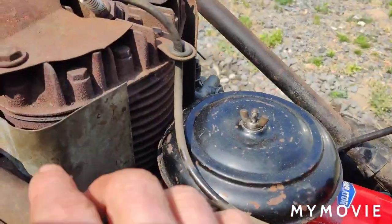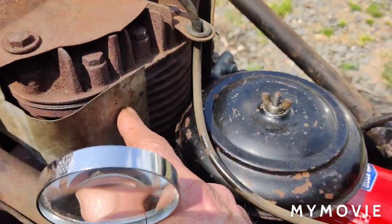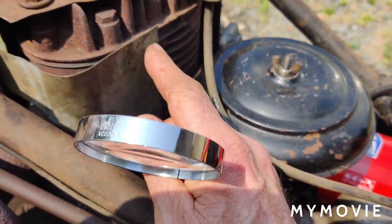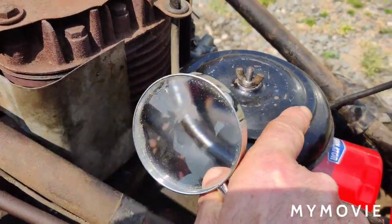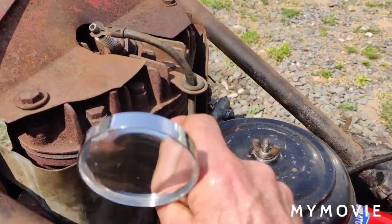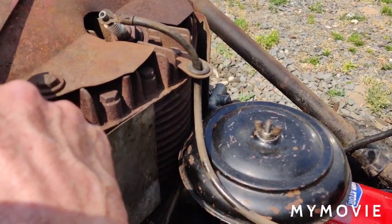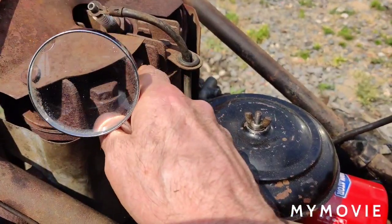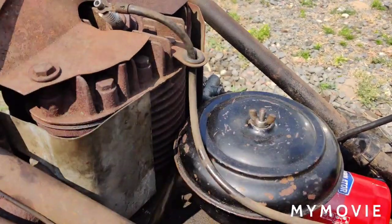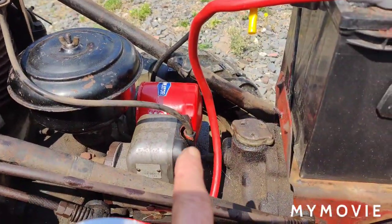Okay. So off camera, I don't know if you remember in the last video, I was complaining that I forgot to put this air deflector on. The cooling fan in the back blows towards the front here, and then you have this deflector on top. You have one here, and you have one on the other side. It just blows cool air to keep the engine cool. If you ever break a fan belt, just shut this tractor off right away. They overheat really quick.